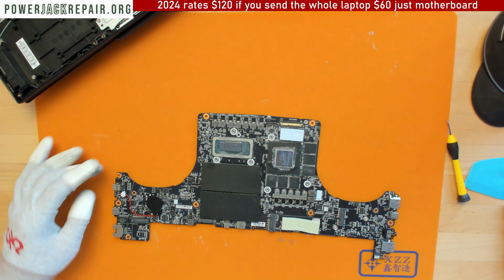So you do need to solder it from the top side, because this is the plus connection here. So you have to solder from the top, but it was definitely soldered from the bottom more than it was soldered from the top. And yeah, there is really no way to solder from the top. You could solder the surface mounted connectors from the top, but how would the machine solder this connector?